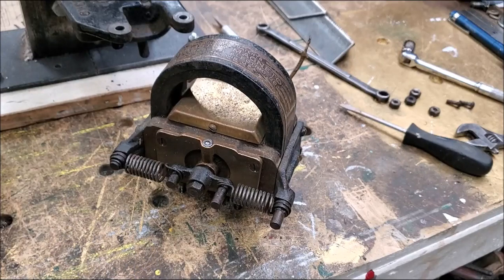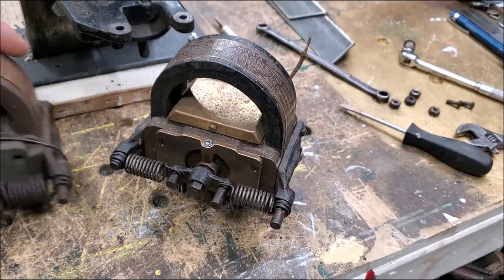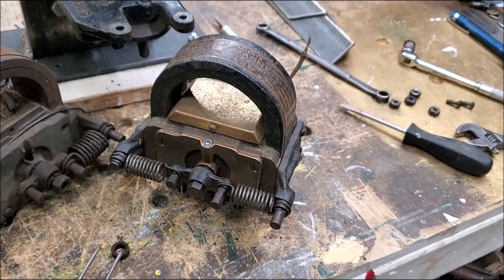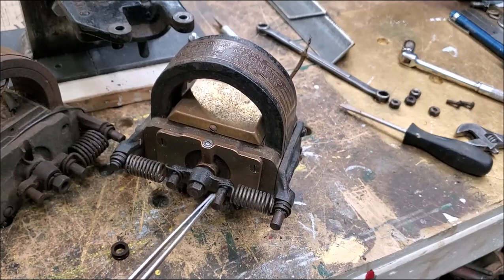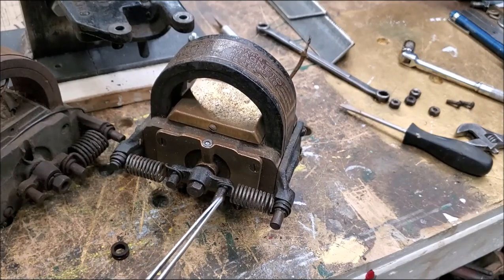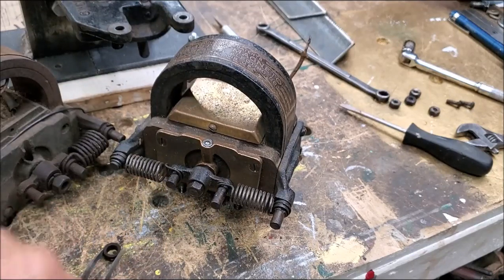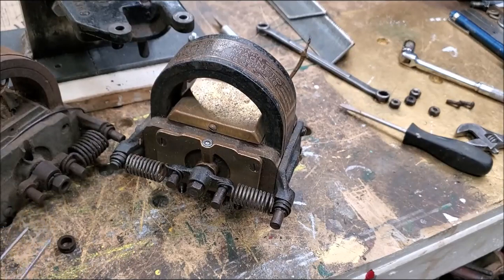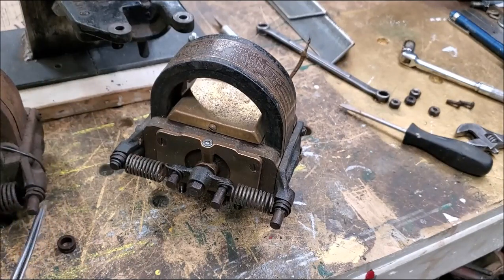The only reason I got these two off the shelf is I'm going to need some parts. I'll take this little thing off — y'all watch this. You see that little roller I just put right down there? That little roller is what's missing on this magneto. It's supposed to have rollers on this thing, and a roller on this thing. It'll go right up there, and then that spring will affix into that groove on that roller there as a bushing.